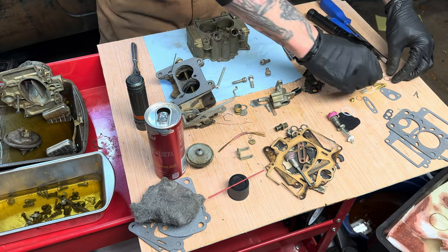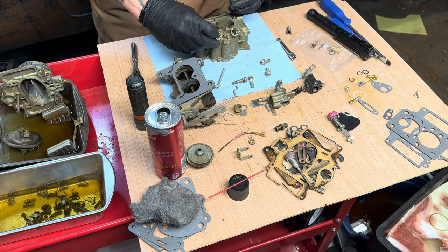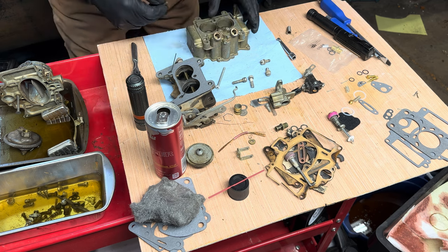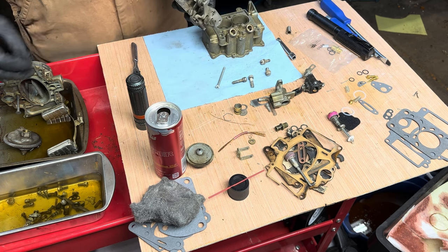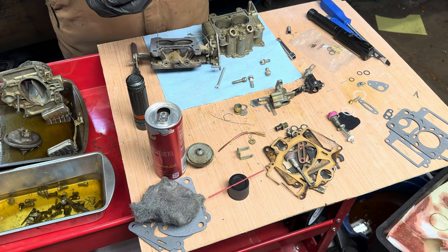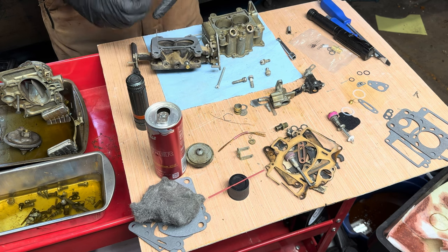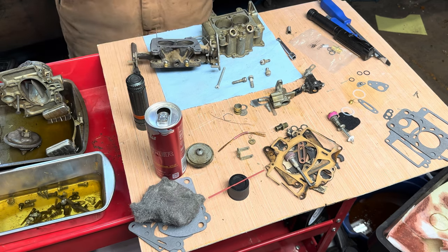And we got these copper washers that go up here. Okay. And these caps. Those are them here. Put the new idle screws on. Comes with new spring, new screw, and then I think the manual says 1.5 turns out, but I'll just temporarily screw them in for now. There we go. Oh, blew a tire.